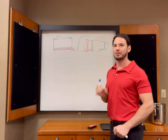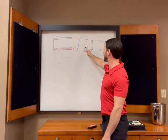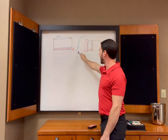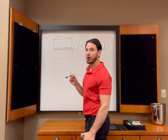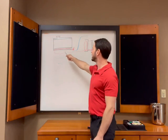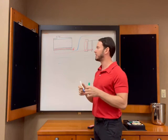That's what happened to the very, very early cars, because they had a problem with the torque converter clutch and it started to spit out fibrous materials, which came out through here and into this radiator cooler. Now on 1992 early cars only, inside here they had a little screen. It looked like a window screen. Of course, it was much finer.